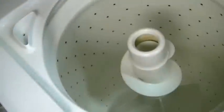When I tested it initially, when I came down after the hot motor smell, I put it right into spin mode and gave it a shot. And it did spin. It spun up just fine, but when you shut it off, there's supposed to be a braking action on the laundry tub, and that was no longer there. So when you shut it, it went from however fast it was spinning and took quite a while to spin down. Then I put it over into agitation mode as such, and the first try, I just got that motor run, and I tried it a couple of more times.